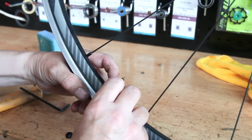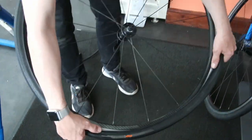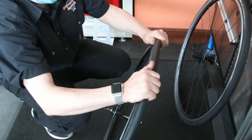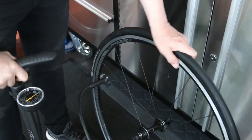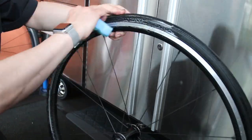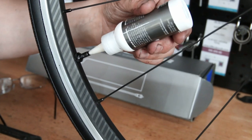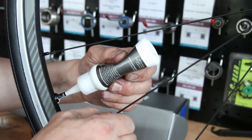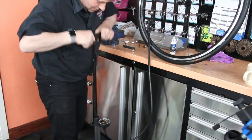This tire took us literally hours to sort out — we had an awful job cleaning it. Then we had a real problem reinflating it. We went through every trick in the book before we managed to get this tire to inflate; it would not grip the bead of the rim. We tried soapy water, air cannons, compressors — everything. But we then turned the tire 45 degrees on the rim and woof, it went up as it should. A very strange one, but our final trick worked.